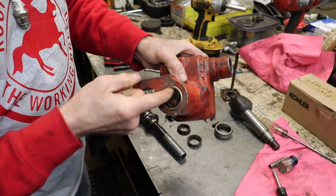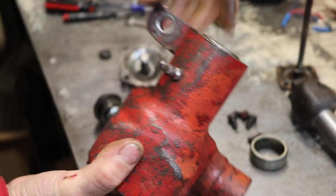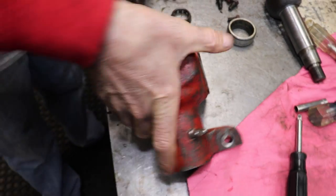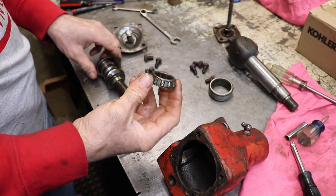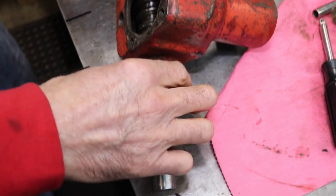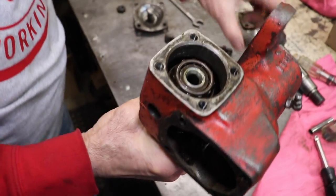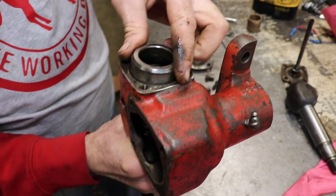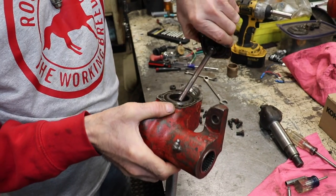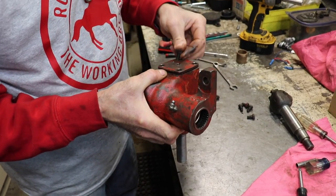All right, got my needle bearings in. Didn't damage them by beating on them. They turn, everything works good. Drilled my hole. This is a very simple steering box. Got these tapered bearings. That goes in first. And there's another one here. Goes on like that. And here's the race for it. And there's this tube with a little spring on it and a little gasket.